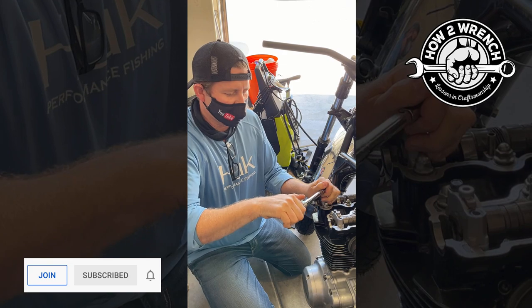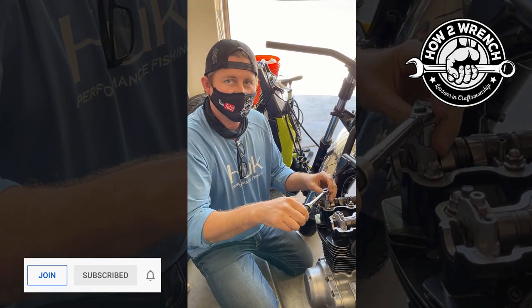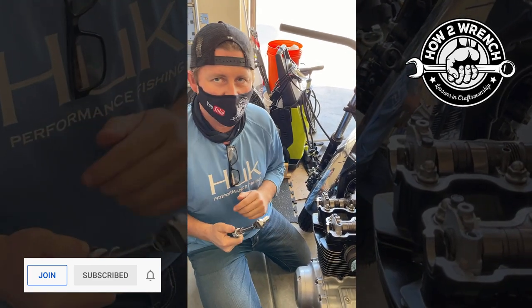I'm not budging this bolt at all, and I quit at almost 200 inch-pounds. That's a hundred percent over-torqued and it hasn't even budged. Make sense? This is how you can tell — it doesn't matter what the fastener is — if you want to know what something was torqued to.